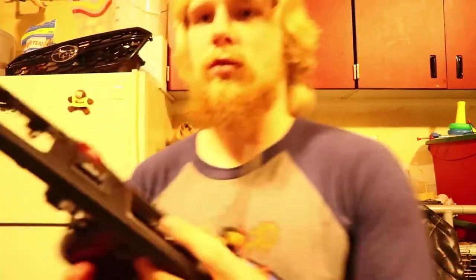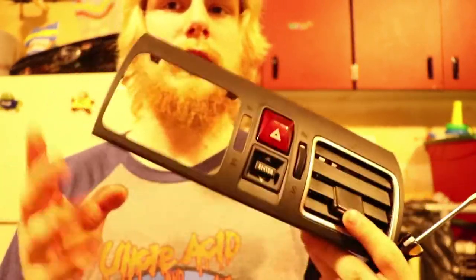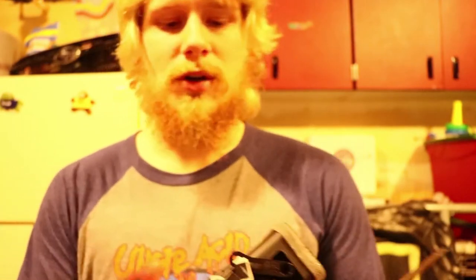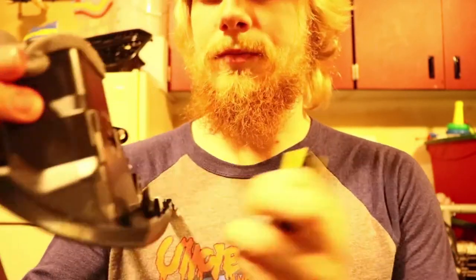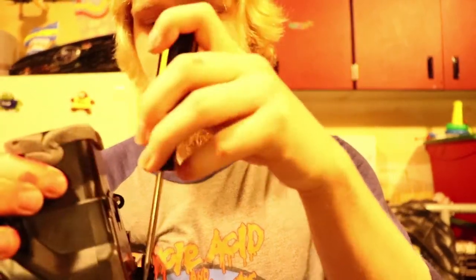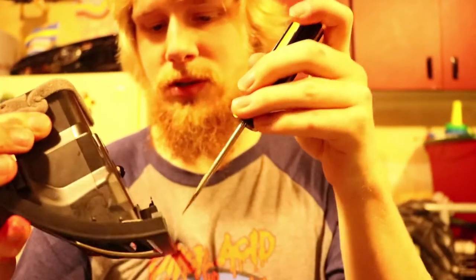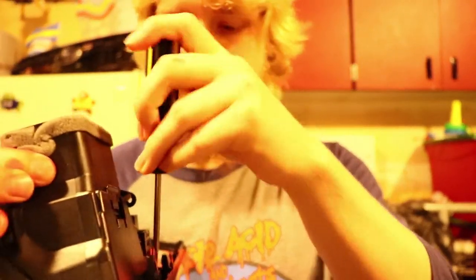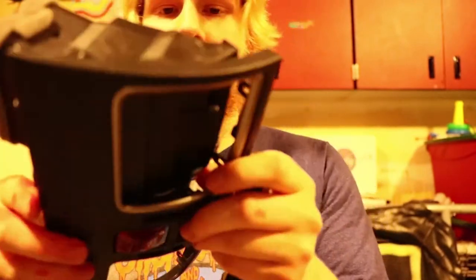Here's the middle part — I already got one of the vents out. It's pretty easy and pretty similar to what you did on both the driver's side and passenger's side, but it is a little different so you're going to have to kind of manhandle it. Get your flathead again and I would recommend starting on this bottom part — it seems to make it much easier. The first one is kind of the hardest, but you just get it until it comes out.